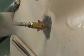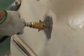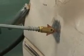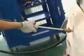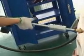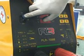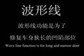After the adjustment, put the triangle piece on the plate. Vertical to the iron, press the gun switch. After a moment, pull the hammer hard. When the iron plate is pulled into formation, rotate the hammer to unload it. Finally, turn off the power switch. Take off the triangle piece hammer.